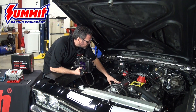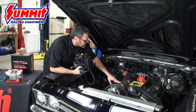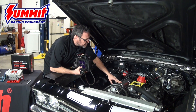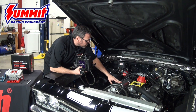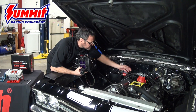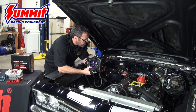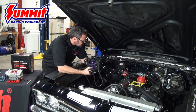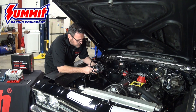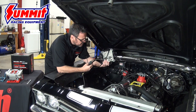On the Chevelle, we've already removed the carburetor, and this car has already been plumbed with a really good fuel system. The owner put an in-tank pump in and had it regulated down to work with the carburetor. It's also got a really nice ignition system, so there was no reason to remove it. With the Mean Street EFI, it's basically: take the carb off, bolt on the EFI.